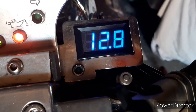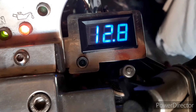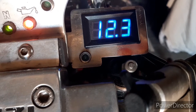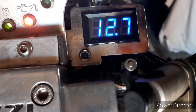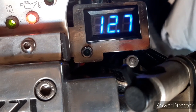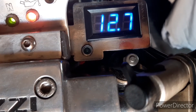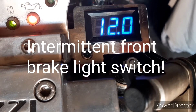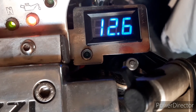One of the best checks we can do is to verify that our brake lights are working — that our bulbs are working and our switches are right. If I just hit the back brake, you can see a nice drop in the voltage. The switch is definitely working. If there was a bulb out, we'd notice because we'd get used to the numbers we normally see and we'd spot a different reading. So I can even check whether we've got a stop lamp bulb out. If I pull the front brake lever you should get the same results — and it's about the same.